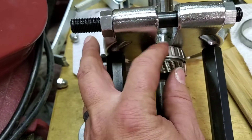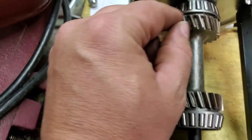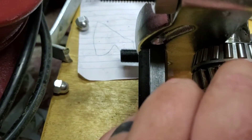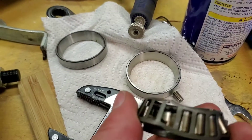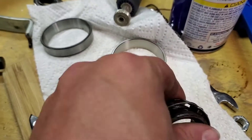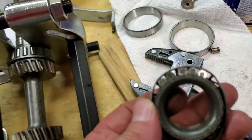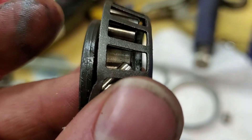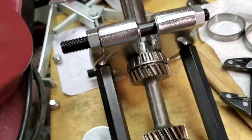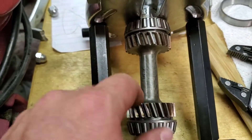I don't think Hearth designed this thinking that this bearing might wear out. What I ended up doing — this bearing puller worked out really well. Just to be extra careful rather than trying to squeeze it in there, which I think this puller is designed to do — it's got a knife edge — but just to be extra safe to make sure I didn't break those gears, I actually ended up cutting the race. You can see here I cut the thing that contains the rollers, and that way I could get my bearing puller on this little edge. On this one it actually came out by pulling on those wheels, surprisingly. The other one was totally fried, and there's a little lip on the inner race lip there, which this thing grabbed onto just great. Popped it right out — took about 30 seconds. Much better than breaking one of these teeth and having to replace this entire machined piece.